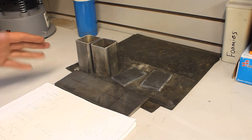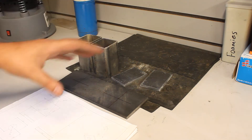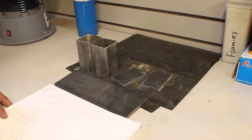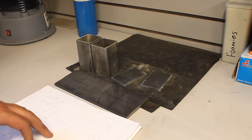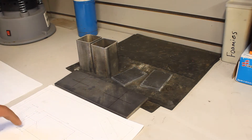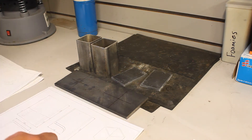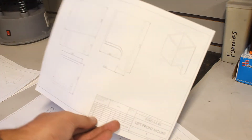What we're going to be doing today is working on the actual mounts for the Ford 8.8 in the Miata rear subframe. What we have here are some drawings that somebody on the V8 Miata forums put up - basically CAD drawings with all the dimensions and stuff we need. We've got the dimensions for this plate right here, and I think I marked these wrong so we're going to check and possibly remark it.